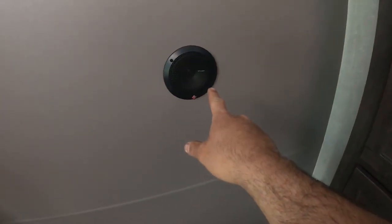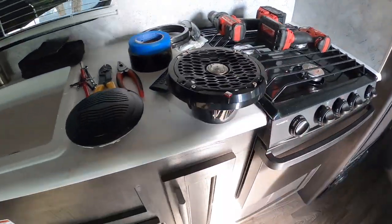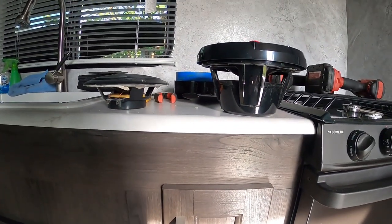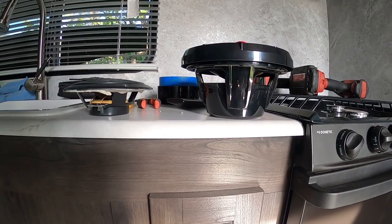These interior speakers are pretty much 4 screws off and 4 screws on. The 6.5's are going to require a lot more work. As you can see, the speaker depth is completely, radically different — it's about double the size. So I'm going to show you guys today how to run those spacers, how to make sure it's weather tight so you don't get any water intrusion, and how you can run these badass 6.5 marine grade speakers. It's going to sound awesome.